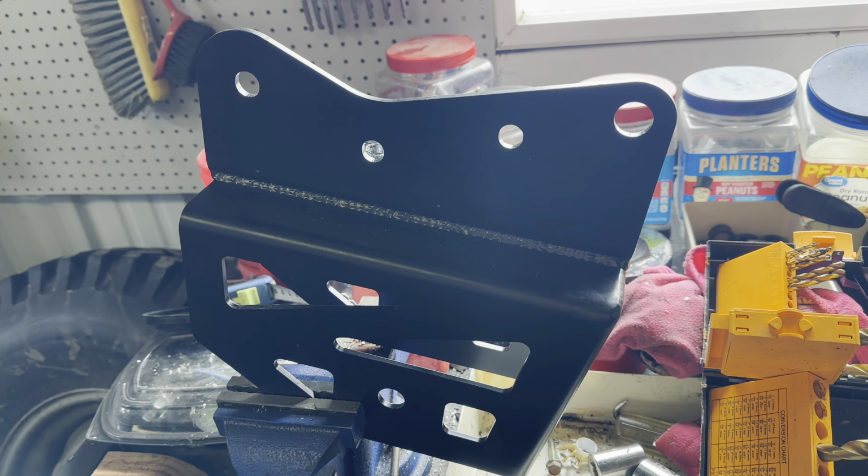But yeah, wherever there's bare metal, and then don't forget about the underside. Just smear that grease all around. Makes a mess for working on it, but whatever. Rather have a mess than have this thing rusting. Now, a lot of people try to wash the grease off their frames and motors and stuff, but here I am just wiping it on. Now that will keep that from ever rusting.